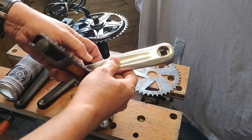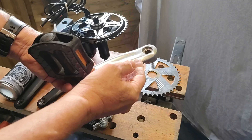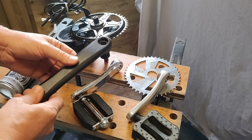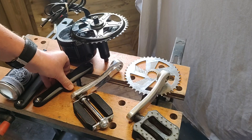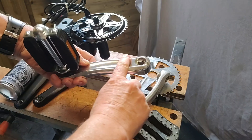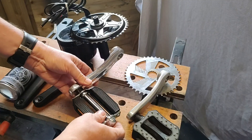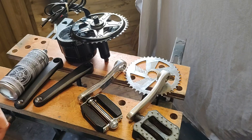I've removed the right hand crank arm from the main sprocket so I can reuse them with the new motor. The fittings that come with the motor are in a satin black finish — it's nice but not the look I want for this bike. If you take these alloy cranks and polish them up they can look similar to chrome and get a really nice finish. Add to that these old style pedals and it's the sort of look I want. Finally, I'll be spraying this sprocket a bright silver colour so it looks something similar to the original.